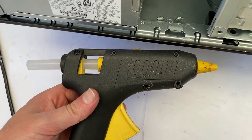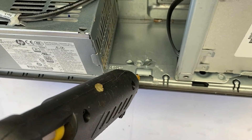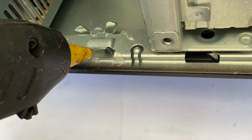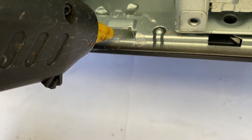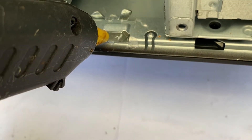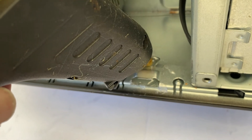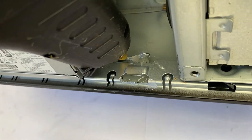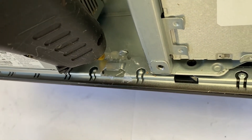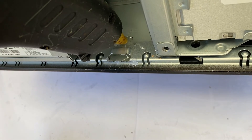One other thing I like to do is use a bit of hot glue. The reason for this is that if I take off the bracket, that M6 wing bolt is going to fall back inside the PC. So I want that bolt to stay fixed to the side of the PC if I need to remove the bracket. Hot glue is great for this sort of thing — it's used a lot with cables on PCs. Because it's inside the chassis it doesn't have to look perfect, so I'm just going to put a bit around it to hold that bolt in place.